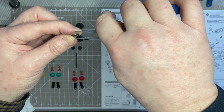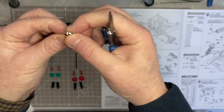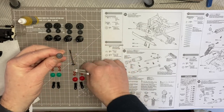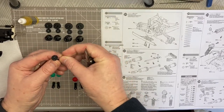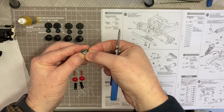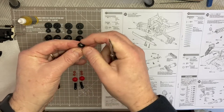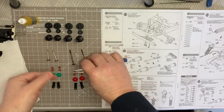Popping these little e-clips onto the piston - you line up the e-clip and gently squeeze it into place. That's nicely into place. Next, once you've got your e-clip on, you pop the piston with the desired holes - we're going with the initial setup which is two holes. Take your little e-clip and put it onto the top of the piston, then use long nose pliers to get it into place. Just check with your nail that it spins and is located in the grooves. I've done that for all four.